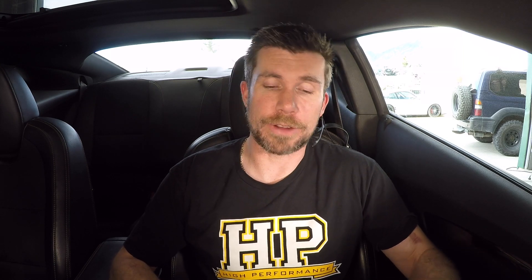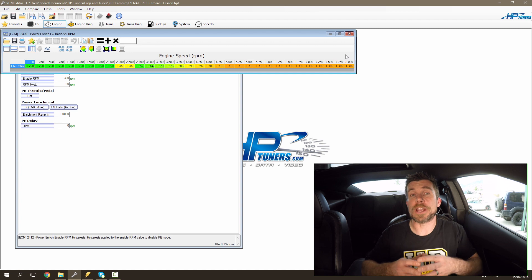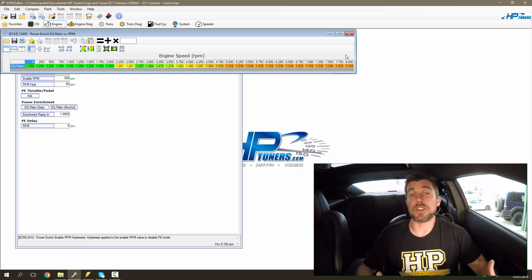We've got our engine operating at idle, and we know that our target air fuel ratio is stoichiometric — lambda 1.0 or 14.7 to 1. You'll remember that in the last lesson we looked at the power enrichment table in the GM software. This power enrichment table was a two dimensional table which defined our target air fuel ratio when the engine was in power enrichment — in other words, in open loop or wide open throttle. So instead of supplying a full three dimensional table of air fuel ratio targets, GM have decided to simply define whether the engine is operating in closed loop mode, in which case the target is always stoichiometric, or in power enrichment mode.